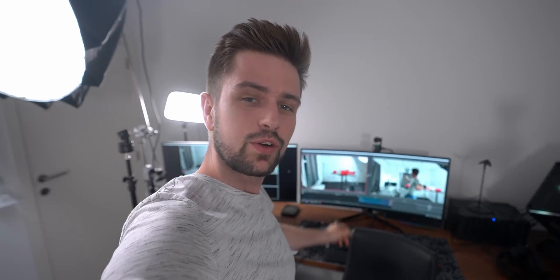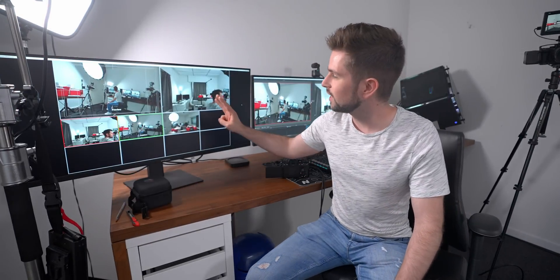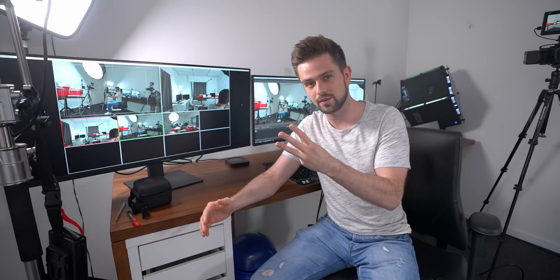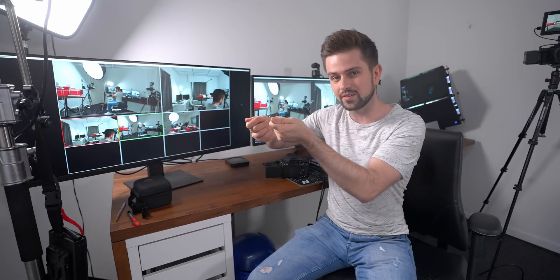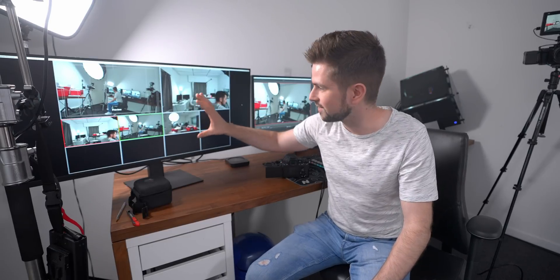I've been playing around with all these cameras and also in OBS with the multi-view, and I have some good and bad news. The bad news is that only three out of the five cameras are working. This isn't the fault of the webcams — they are awesome. The reason is that my PC can only handle three video streams through USB. You can upgrade by adding another USB controller — it looks like a mini graphics card, goes into a PCIe slot, and adds a few USB slots so you can handle more cameras. The good news is that three of them are working perfectly and it's awesome.